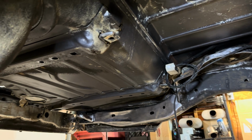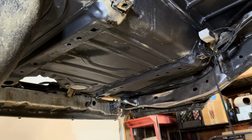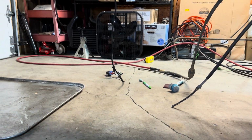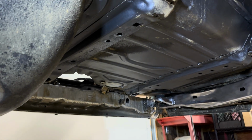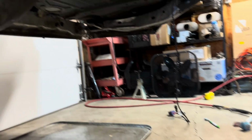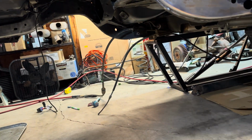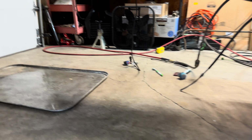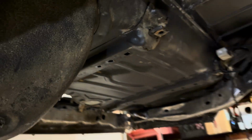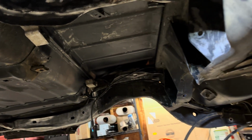The cleaning, I used a red Scotch-Brite pad to loosen up the dirt. Then I pretty much used those brushes there and a toothbrush as well to get in the small spaces. Took some Super Clean, which is this right here. Went to town, sprayed it off, then wiped it back down with some Simple Green, which is this stuff here in this bottle. And then I took some of, again, the cleaner degreaser from this bottle here. I let it set. You're supposed to actually let it set so it can kind of do its thing. And then rinsed it off.